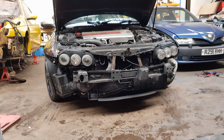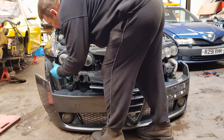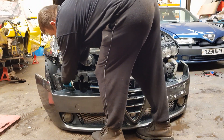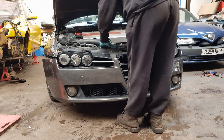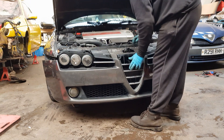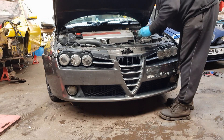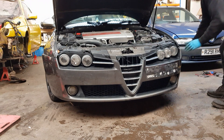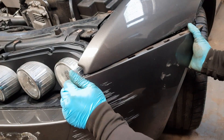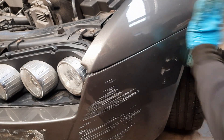To refit the bumper, offer the bumper up to the front of the car but don't fit it just yet. Place it there, plug in your electrical connection. Lift it up over the right lock. Secure that in place there. Pop a bolt in there to stop it from falling off. To refit this, it clips on at the front. Just push those in there like that. And then just push that back.